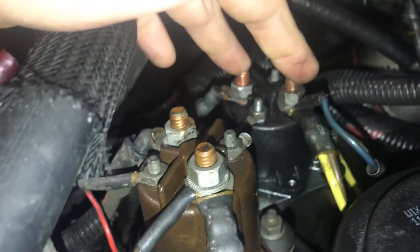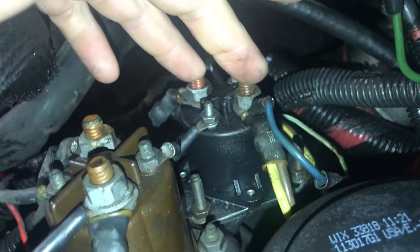I ain't got no complaints. But if you're ever in a pinch, you can totally just jump across those two posts right there — this one and this one on the back relay. Jump across those two and the truck will fire right up. After holding it on for about 30 seconds, just long enough for the wait-to-start light time, the truck will start. If you're ever in a pinch, go ahead and try that — it'll definitely help you rule out issues with the vehicle. Y'all have a good night, appreciate the watch.